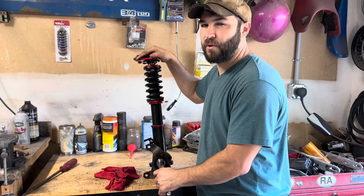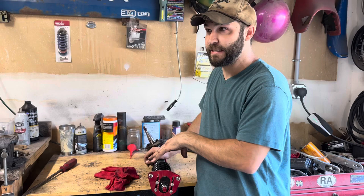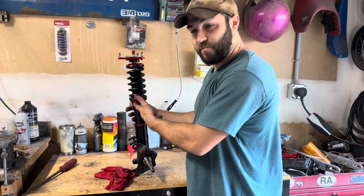However, being that this is an early TE72, the camber hat will not line up. 82-83 should just bolt straight onto the AE86 camber plates. The early cars, one of the holes is too far out, so we'll just drill a new hole for that one. That's how my wagon is. It's not a big deal. So the fronts, well, that's them.